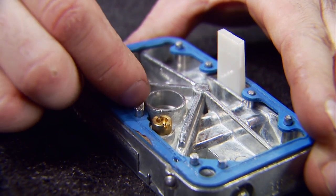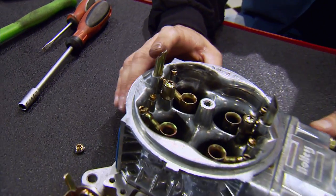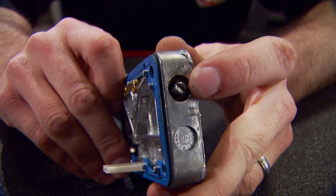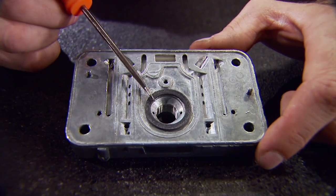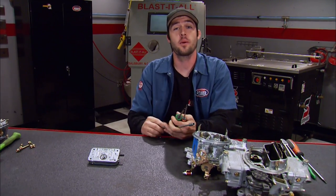The main jets are located in the metering block on the fuel bowl side. Each jet has a number representing the orifice size, available in sizes 40 through 100. Once you get to about size 66, the number on the jet and the actual orifice size aren't consistent, so pay attention to that. The final journey for fuel through the carburetor is to the throat, where it's introduced by the discharge nozzle — also known as the squirter. Now let's talk about the metering block itself. All primary ones have idle adjustment screws. The power valve restriction channels — those two holes — are sized to match the CFM rating of the particular carburetor. So the larger the carburetor, the larger those channels are.